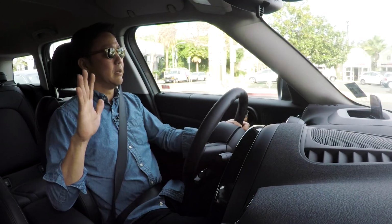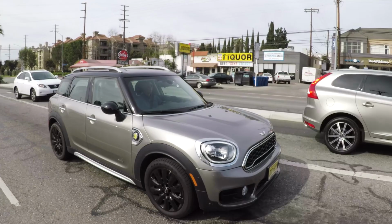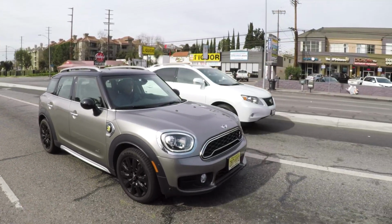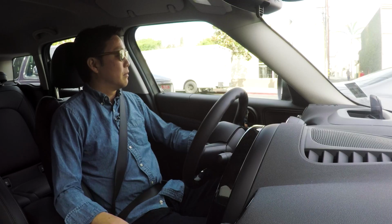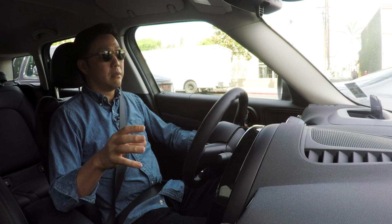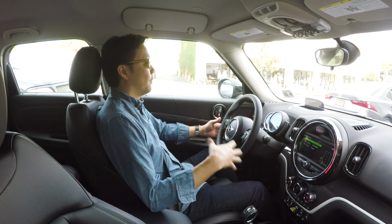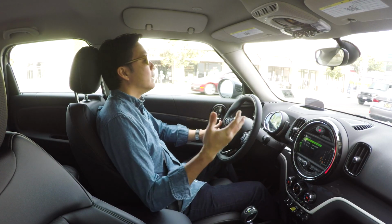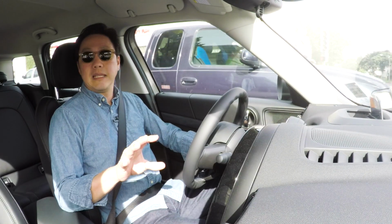It's almost like it gets a little mushy at the top of the brake pedal stroke, and then as you slow down or as you give it more pedal pressure, there's a little more resistance. That's when you start feeling the pads start to grab. My colleagues have commented that there are more issues at low parking lot speeds where they can be a little grabby, a little abrupt. And on the flip side of that, when you're on the highway and you need to get on the brakes, they can feel somewhat disconcertingly light.